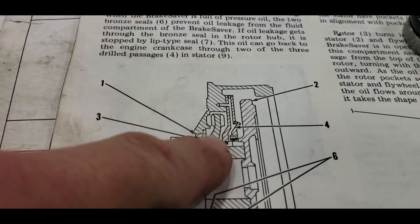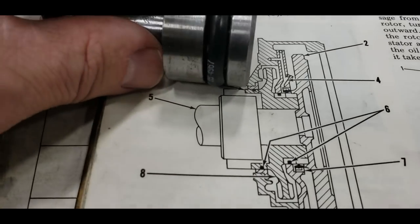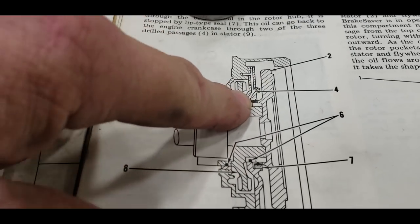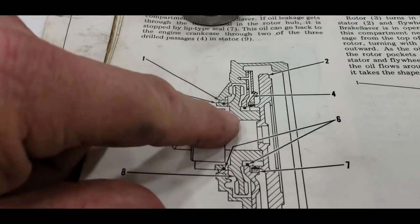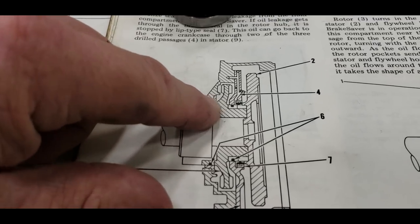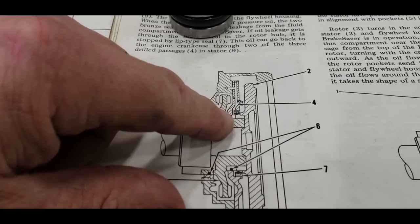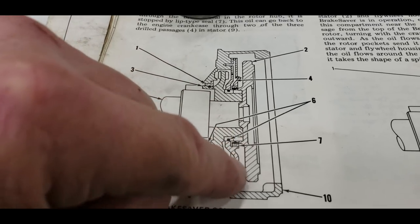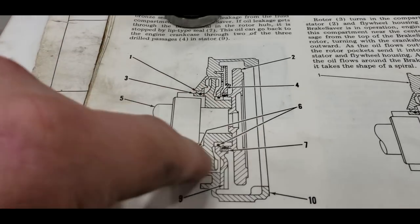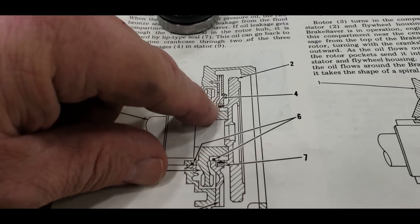This has two other drain backs — this is not a drain back. The oil comes through and down this drilled passage into here, and it lubricates this seal. When the retarder's running, you can get up to over 100 PSI inside this rotor. You've got a brass piston ring seal that holds that pressure. Down in the bottom there are two drilled passages that drain back, one on each side and back into the crankcase. That drains any leakage oil from the brass seal, and the lube oil that constantly comes through for this seal.